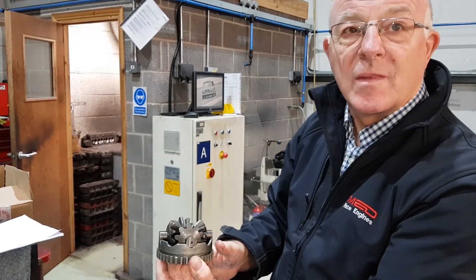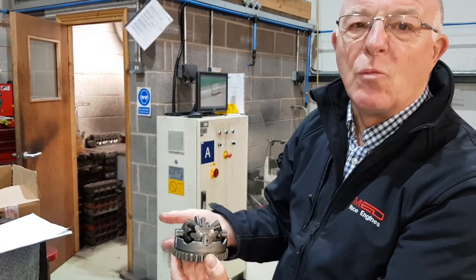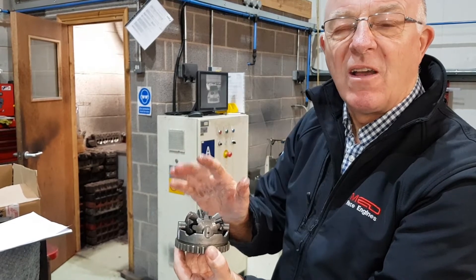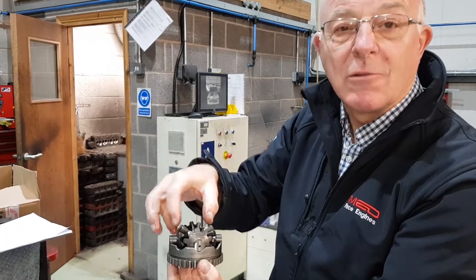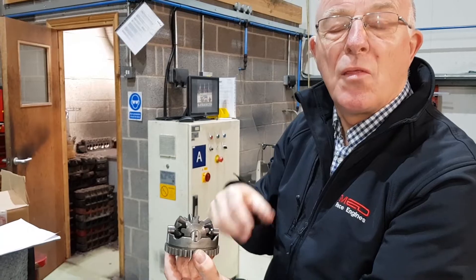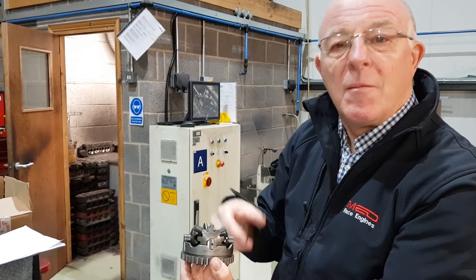If you want to play around with that, there are different options — they do 101 different ones, but really 3090 is for an out-and-out circuit car. If you find it's a little bit too aggressive, pop the diff out and swap it to 4590. If you've got a rally car that you occasionally use on the road, go with 4090 in the rally car.